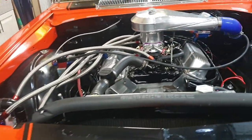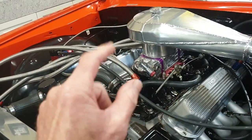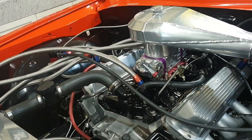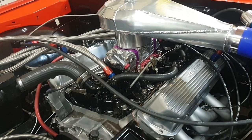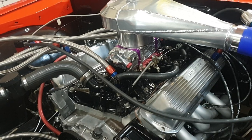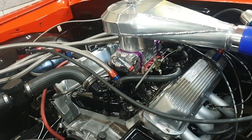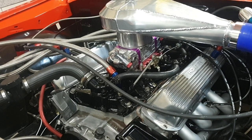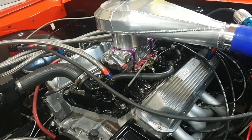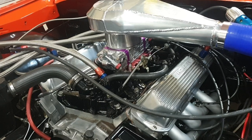Excellent — can't wait! I've also been busy with another little issue: I had a problem with the carb. When I was down at the track last, after the second or third race I noticed when I came on to boost or put the foot down I had this sort of dead feeling — like a flat spot. So I pulled the carb off just to check it, not knowing if there was any dirt or whatever.